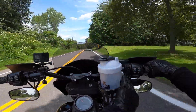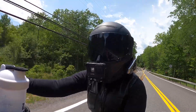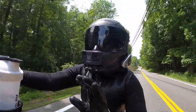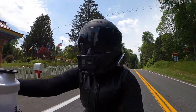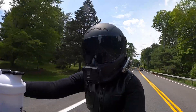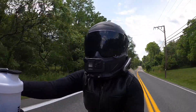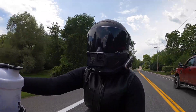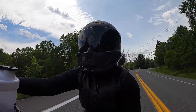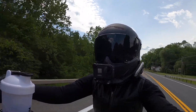I'm not going to always want this on here, but I can just unscrew this and leave this end piece in here, so that's not very intrusive. You gotta be careful when you put it upside down like I did if you have low bars and risers. I have 8-inch risers, 2-inch pullback. I think if these were stock height, this might kind of hit here doing turns. So just like when you flip your mirrors or mount anything to the bars, before you go out you want to make sure you have clearance — you always want to do a full turn on your bars to make sure you got full clearance.